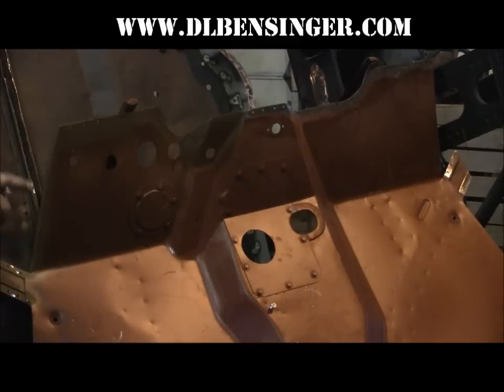We're going to apply a weld through primer. The weld through primer has a high copper content, and that way it gets good electric conductivity, so the electric arc welder will make a good weld and still leave primer there, and it's going to keep the seam from getting rusted. So we'll treat all the areas we're going to weld with this high copper content weld through primer before we fit the body to the floor for the final time and get ready to weld it in.